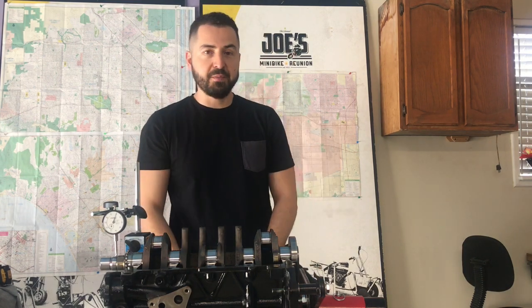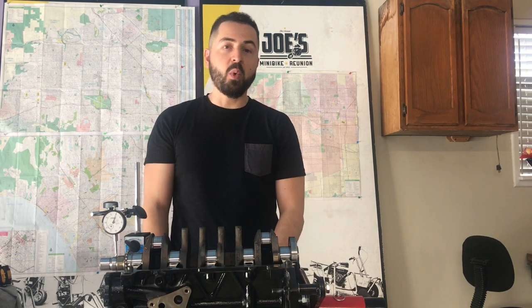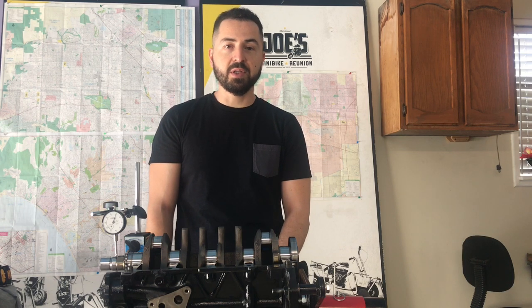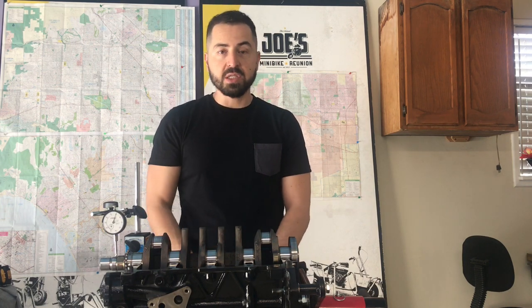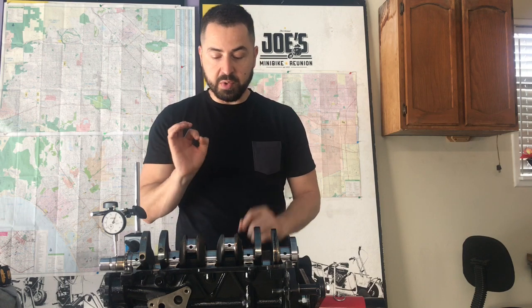Welcome back to Father-Son Rebuilds. My name is Jaime Senior — my son's not with me at this point, but I'm recording this for myself. We're in the middle of a 2003 Mini Cooper S rebuild. We spun rod bearing number three, and it's been quite an adventure. Due to COVID, everything's on backorder or extremely expensive. This crank has been welded, balanced, chamfered, ground, and polished to the nines.